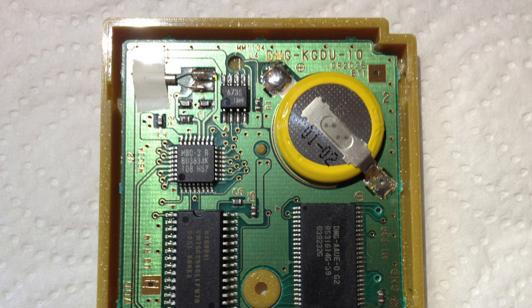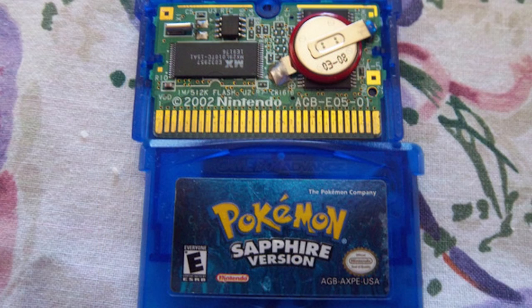Certain Game Boy Color cartridges have batteries in them. These batteries, unlike later Game Boy Advance cartridge batteries, actually stored our save data. They were always running in order to make features like day and night and the in-game clock possible. That means that since you bought the game, a tiny little clock of doom has slowly but surely been counting down towards the destruction of your beloved save file and all of your Pokemon. And you may not have even realized it.